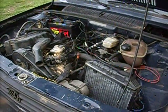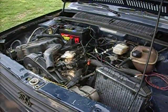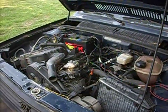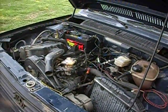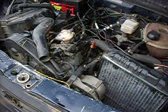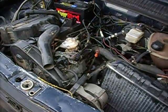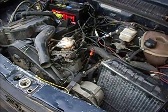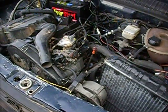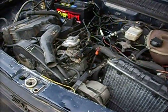Some of the other modifications that needed to be made: we had to take the oil pan, the oil sump pickup, and the oil filter assembly off of the original car to set it in here to make everything fit. Because of the way it's configured, it was interfering with the way the motor sits in here. So we had to use a different oil pan, different oil pickup tube, and the oil filter face to change the orientation of the way the oil filter sits in there.